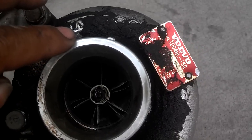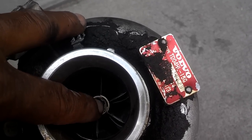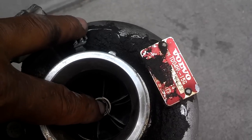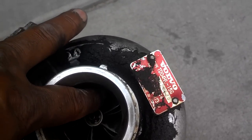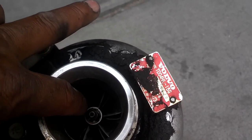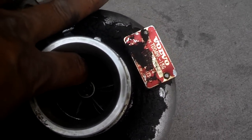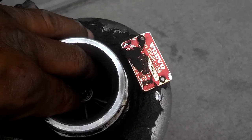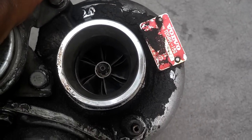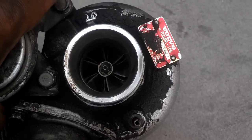The best way to check for wear is to take your finger down here and see if you can get this blade to wiggle side to side. It has very little side-to-side movement — you can't make it touch the walls of the turbine. Also, you spin it and see how freely it spins. And last but not least, you try to get it to move in and out — that's called in-and-out shaft play. I can't pull it toward me with my fingers. It has literally no in-and-out shaft play. So this turbo, even though it had almost 300,000 miles, was in excellent condition — as good as any turbo with 50,000 miles on it.